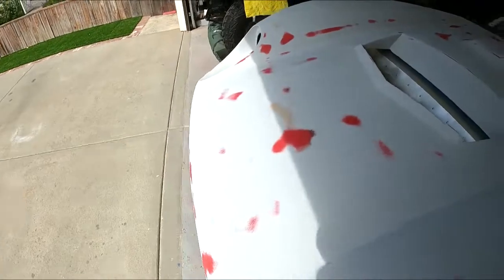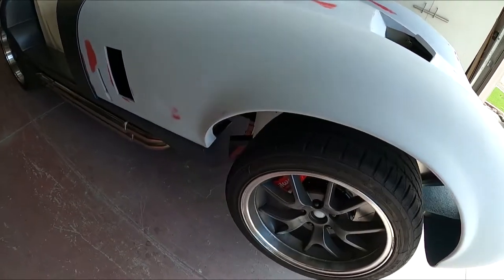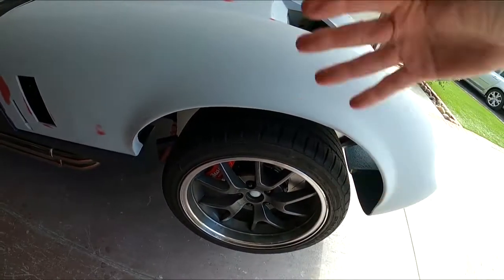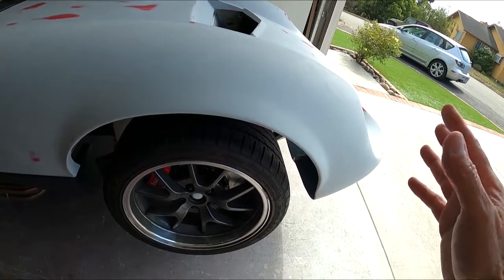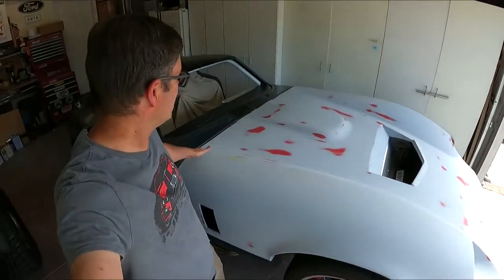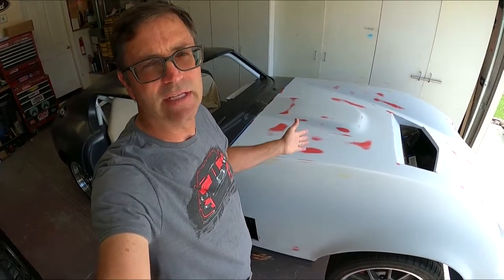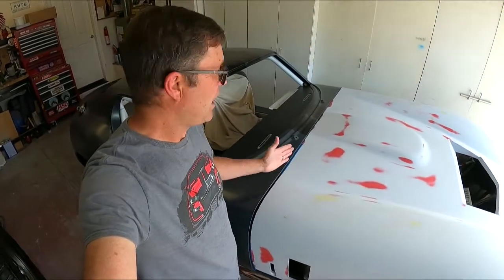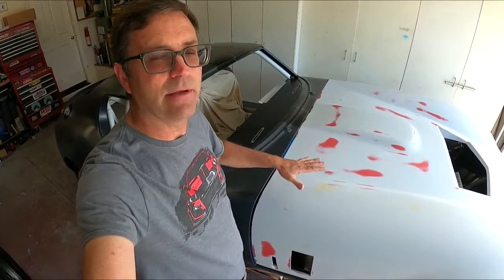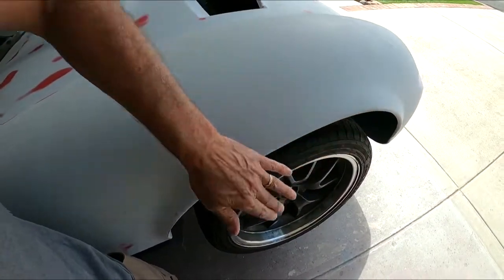The nose is going to be a major, major pain - a lot of work. My first step is to center it side to side, get it square on here, then mount the hinges because the hinges are adjustable. Once the hinges are set up I can swing this thing up and down and figure out how much I need to take off. I'm going to plastic-cover the entire car, start grinding the back of this off until it fits, make sure the alignment's good, then gap it and go from there. I'll measure from the shock tower out to the lip.